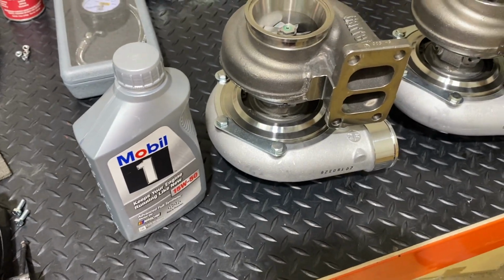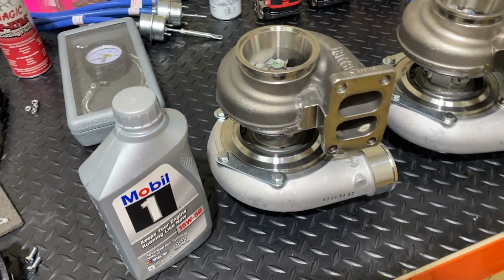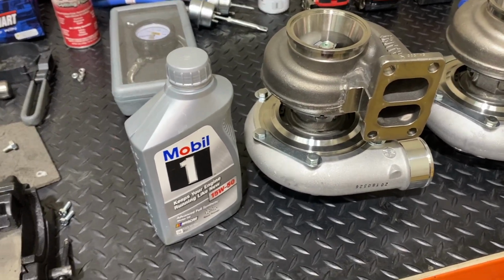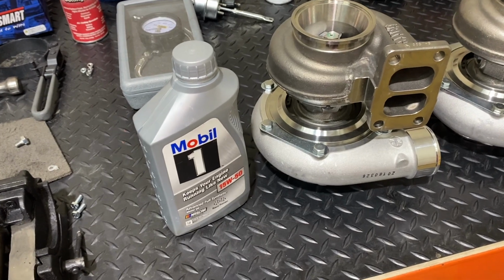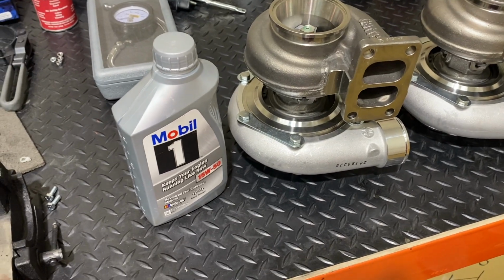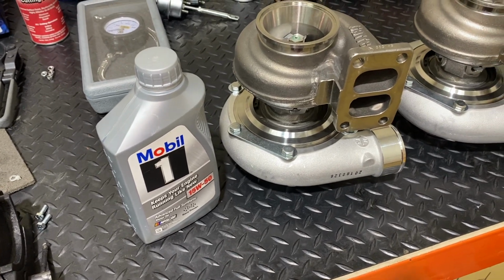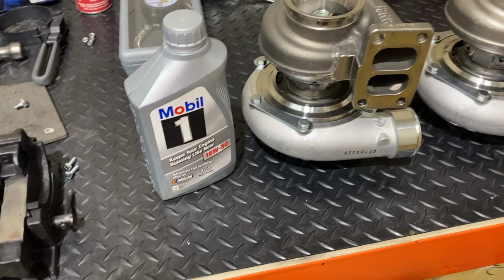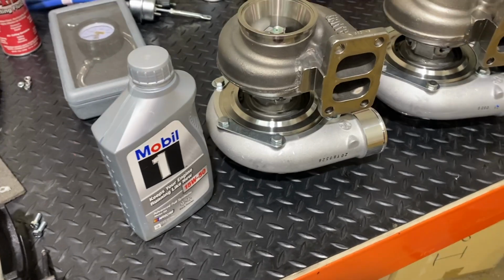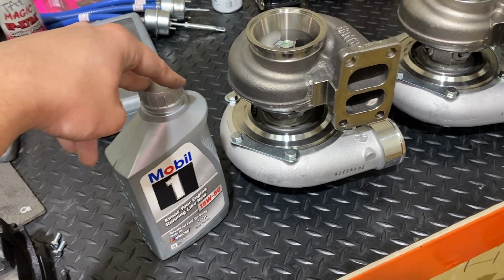So the main factor you have to take into account is the actual maintenance you give it to make the power. Because a lot of people say, and it's a myth, that the N55 suffers from rod bearing failure. But I mean, the oil interval from the factory is too long, so it starts to build up sludge, and the auto start stop on the engine actually makes it start wearing the bearings faster. So I turned that off. I changed my oil every 2,000 miles, and it's actually running great.